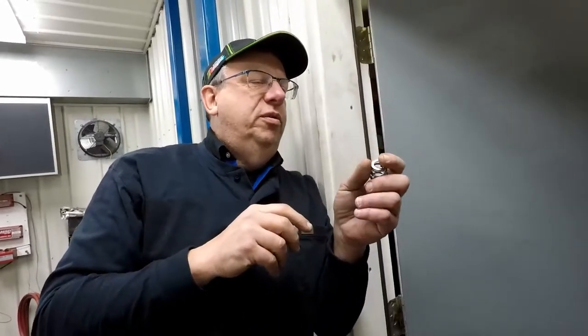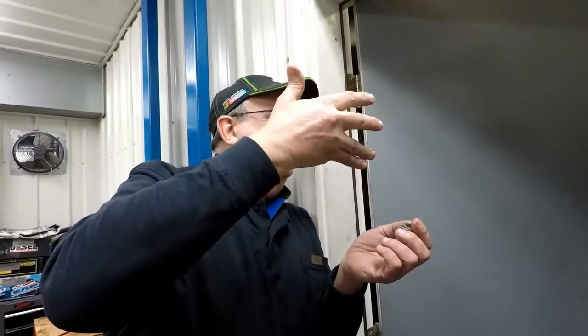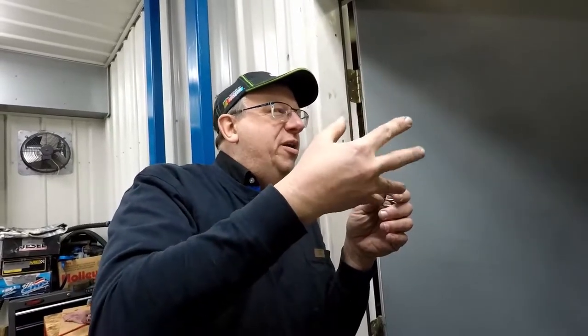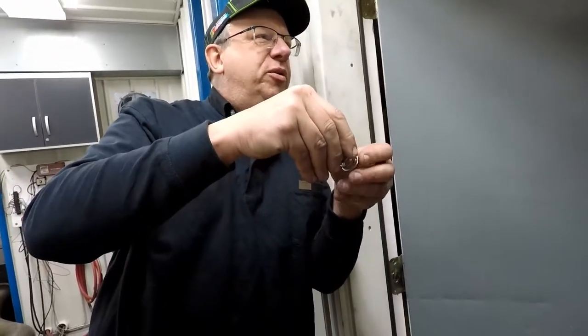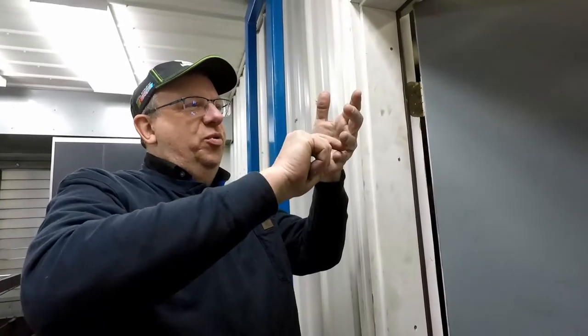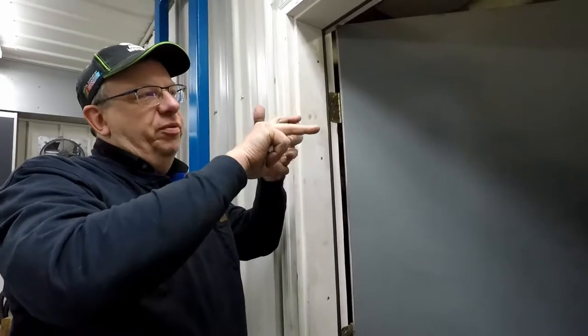Yeah. Now if I had a spring with 300 thousandths lift instead of 500, and I put them in at the same spot, an inch and a half, they're going to go down to an inch two. That's 200 thousandths away from where they can be. It's not squeezing them all the way down. It'll start to squeeze these upper ones first, and not the middle one. It'll literally come down and leave these, and it'll wear these out quicker and make them break rather than use them all. You want to use them all, not just half of them.